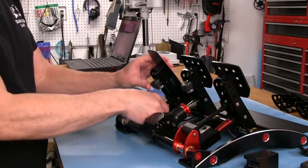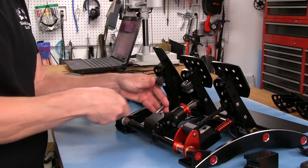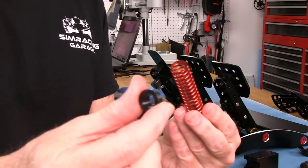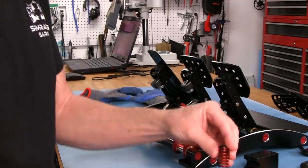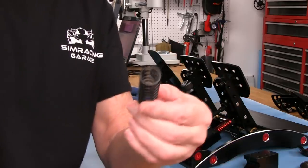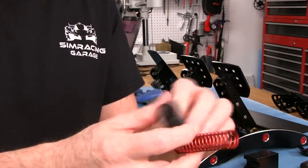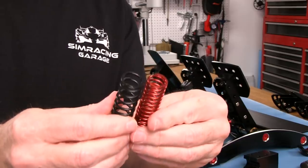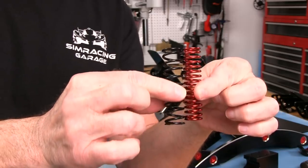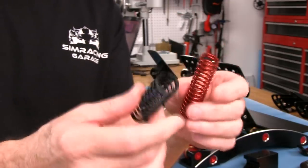We'll pull the spring off the rod along with the back bushing. There's the spring - it has bushings to help guide it over the rod. Comparing that to the replacement black spring we're going to put in: you can see the bigger diameter, the bigger height, and the wire gauge is bigger too. So it's going to be a stiffer spring. I think it's going to give me the stiffness I want, because the original was just a little too light - you can actually compress it with your fingers, which some people might like.